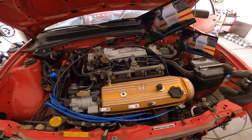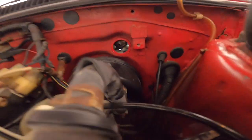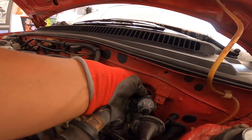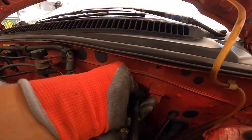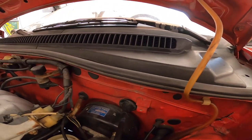This is always something good to check — it's a quick, affordable fix before diving deep and spending money replacing your clutch, because your clutch might not actually be slipping; your cable could just be stretched. I'm going to go ahead and thread that through, hook it up, route it over, and hook it back down the same way we pulled it out. Side note: there is a metal tube within the firewall that is the perfect size for these O-rings. You pass the horseshoe through that little metal tube, the O-rings seat within it, and the rubber grommet seals around the hole in the firewall to keep out water.